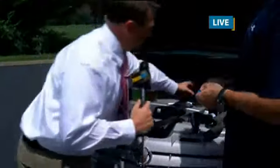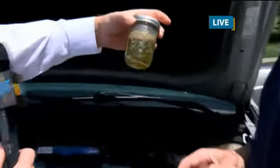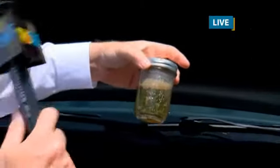Those things are visible, so you can look at it and see what's going on. As you noticed, you pointed at different types that we have here, but of course we do want to show if you don't change it out or keep up with it, it's supposed to look like... Yes, sir. It's not. When should someone look at this or consider getting that coolant flush? Well, they need to check it about every 6 months. The flush needs to be done about every 30,000 miles.